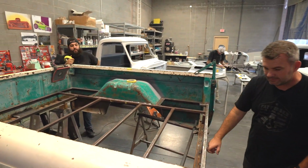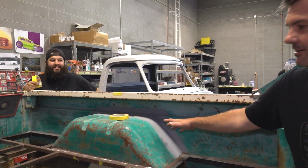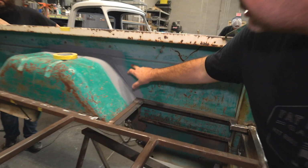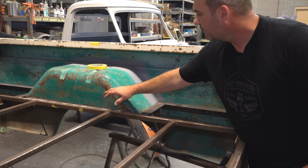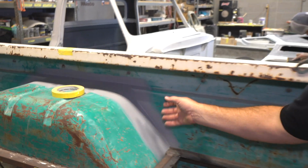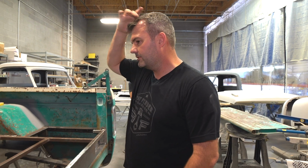And then we'll have to paint this and then this, but we'll have to do a little bit of patina look, fauxtina they call it. And so then I'll get in the paint booth with Juan and we'll try to make it look like a few scratches, a few things like this. We'll try to reproduce that right in here. So we'll actually start with this base coat. We'll come up with a color here that we spray, and then we'll spray maybe another color like a mustard color over it, and then from there we'll spray this green color over it, and then we'll distress it, and when we like it and everything's good, then we'll re-clear this little section with a semi-gloss clear. Not shiny, even though we'll buff all this up and it'll be kind of shiny. We don't want to spray high gloss because it'll actually dull itself back down in a couple months. So we just want it to look nice and clean. So we'll do just a semi-gloss finish on that.